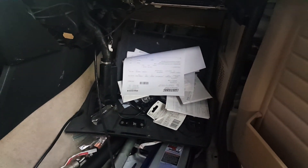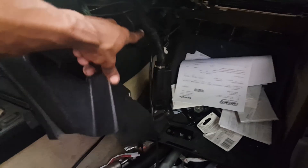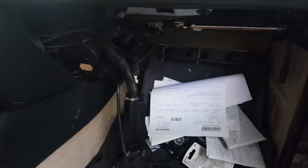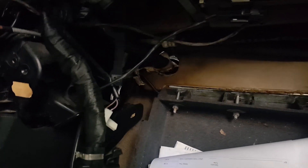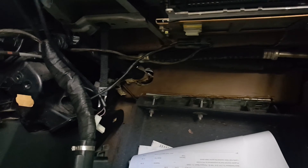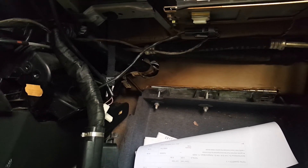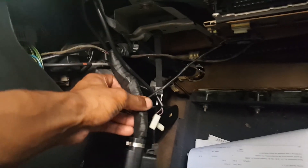Back inside, you have to remove a few pieces: first drop down the glovebox, then there's a little cover up here with two screws and a couple of small plastic clips, and another side cover with one screw and another set of plastic clips. Once you get the wire through you're good. For me, I also have to wire in that yellow wire for the analog signal to the ECU. Instead of tapping into the original wire and messing with this harness, I'm going to go straight through the same seal for the wiring harness, out to the O2 sensor, find the correct wire, and pin it to that — so I can connect and disconnect it without splicing into anything.